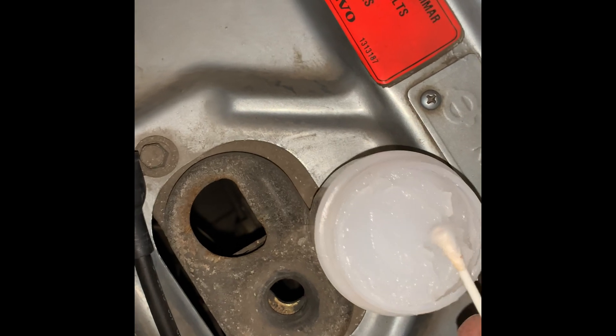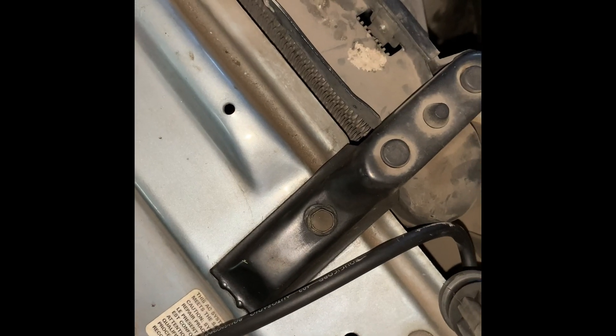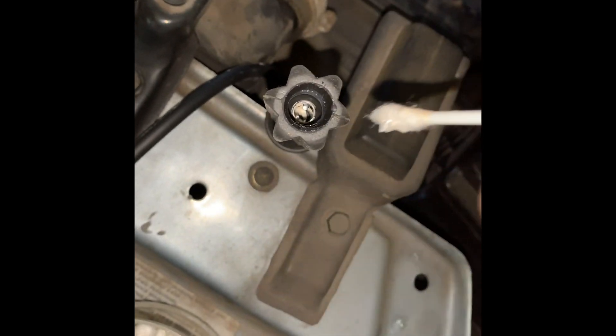Now you measure which cable matches the same length, then apply the dielectric grease. In terms of which cable goes where, it's straightforward: because of how the engine is oriented, you always need the shorter cable in position one and the longest in position four. For the grease, use a cotton swab and spread a thin film only on the inside wall of the wire boot — that's enough to prevent arcing between the spark plug and the engine block.